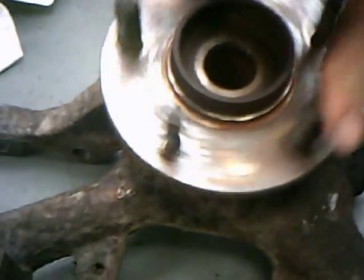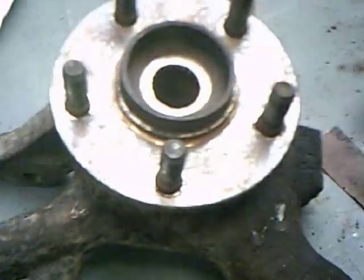So, that thought in mind, I've supported the bottom, and then the hub is going to go in there on top like that. And I'm going to go ahead and give it a press. Down we go. And you'll feel it hit some resistance, and that is where you'll stop once it shoulders out, right about there. It should spin nice and easy. We'll go back, put this back together, and be ready to go.